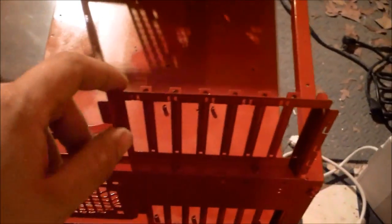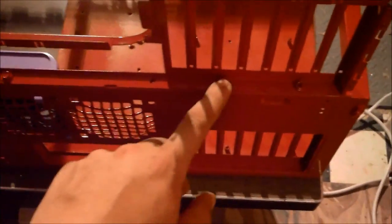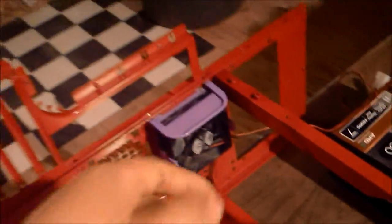This case I built out of two old cases. I basically just took this baffle that you screw the cards into off another case and screwed it on top of here. I drilled out all the rivets for the bottom of the thing, and this support was down here — I took it and screwed it in here using metal tapping screws. I also added two case fans, and I already had one case fan.